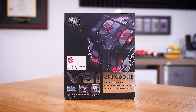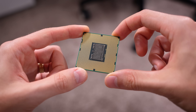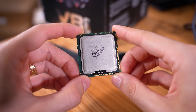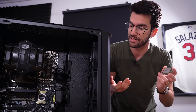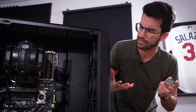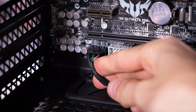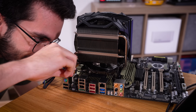We've ruled out the graphics card, we've ruled out DDR3, we know the power supply works and it's brand new. We've ruled out the CMOS battery and now we know the BIOS isn't the issue. CPU mounting pressure? Maybe the cooler's not installed correctly, or maybe the CPU is bad. Maybe the motherboard is bad — even though these are brand new, they could still degrade in theory. I do have a Core i7-920, the cheapest CPU supported by this X58 board. I've tried every available DRAM slot and disconnected all non-vitals. I think I'm just in denial at this point.